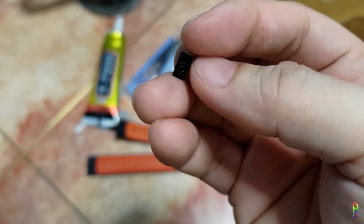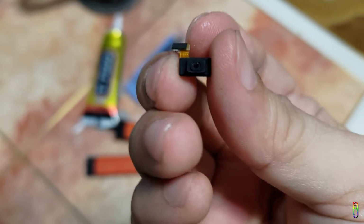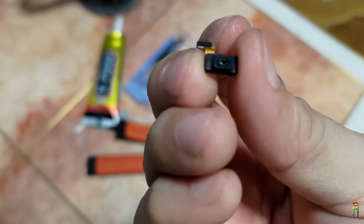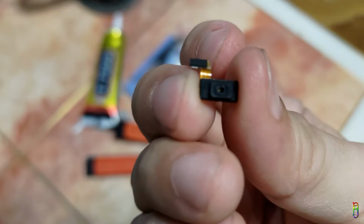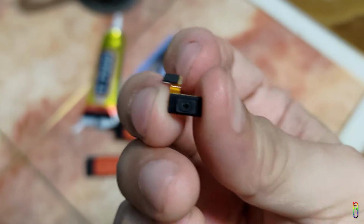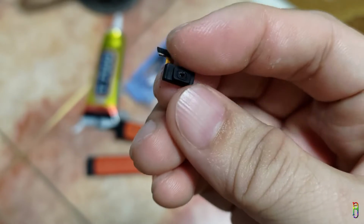But why does the barometer cause shortages on the lines? Well, remember the hole on the side of the watch. The barometer needs that hole to be able to function. That hole is not really open at first. It has a thin white sheet covering the hole. But after months, or in my case, years of usage, that thin white cover deteriorates, thus opening the hole.